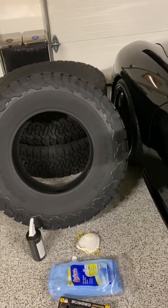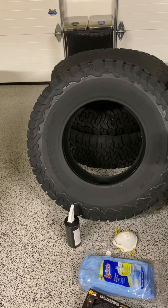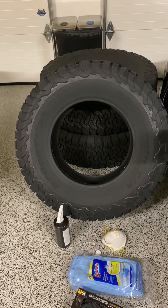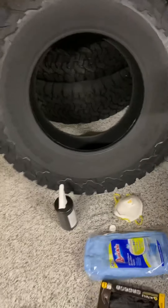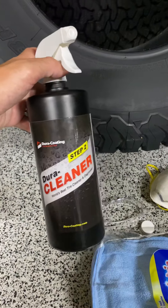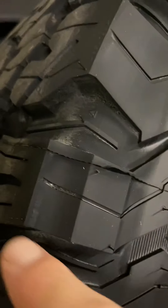If you've ever noticed when you put your tire shine on and maybe in the winter you go a week or two and it turns brown — that brown is the silicone layer. That silicone just traps dirt and it looks like crap. So basically what Dura coating sells you is this two-step process. The first is this Dura cleaner, a heavy duty degreaser that pulls all the silicone off.